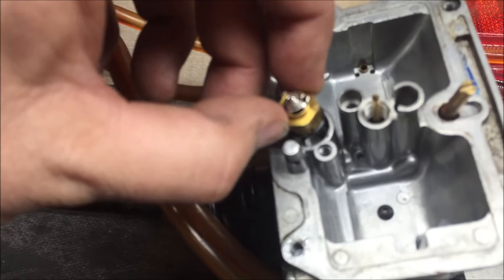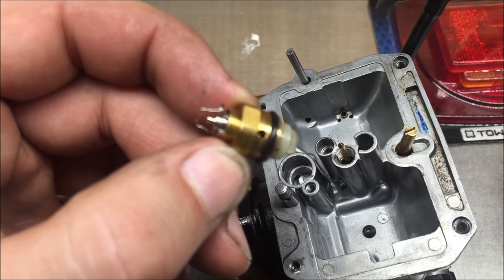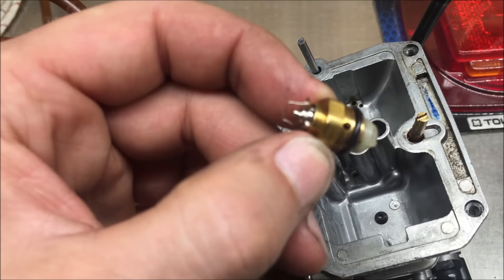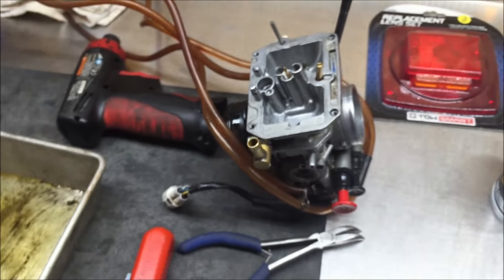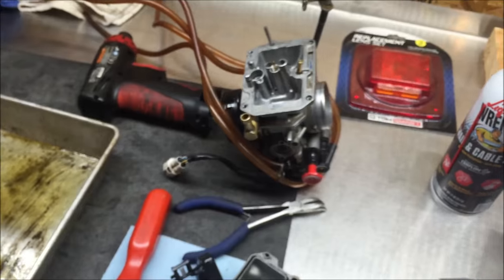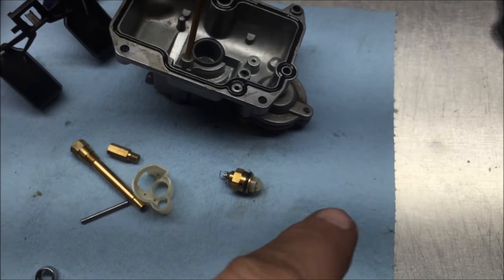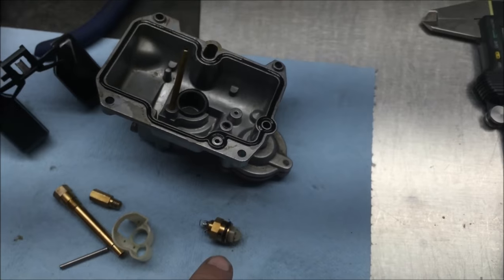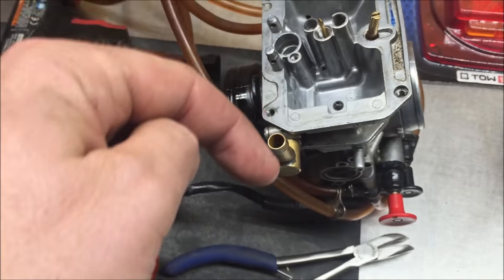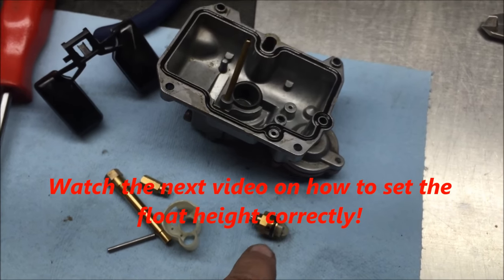The fact that the O-ring's not torn — what can happen is that the flooding, if you will, is going to be minimal while you're riding the bike; it's just going to make it run richer than it's supposed to. So I'll have to go back and check the spark plug again and see if there are any clues that this was just a rich running bike. But without a doubt, the float needle and assembly need to be pulled out, look for those filters, clean thoroughly all the way through the track, and make sure you're not restricting any fuel flow.